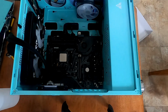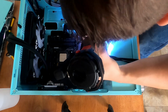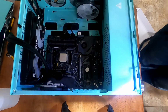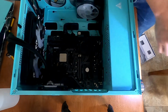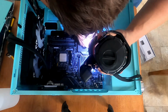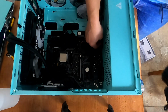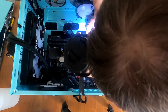Okay, hopefully that's installed the right way. Pretty sure it is. Next, we've got white, orange, blue, and green. Blue one is called reset switch. So we do power first, because power is the top left, and I just did the bottom left. So let's find, oh, the power LED, I'm sorry, is top left, not the power switch. Power LED minus is white, power LED positive is green. How about that? Power LED positive is going in the top left. Power LED minus going right next to that.